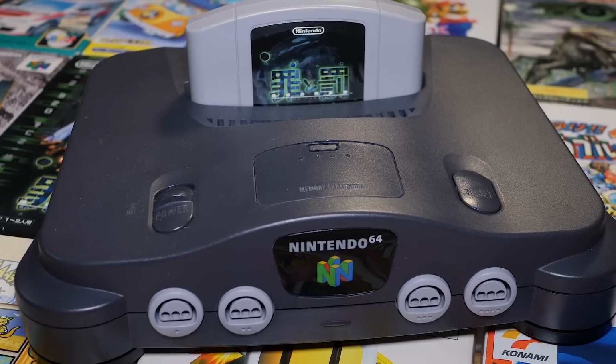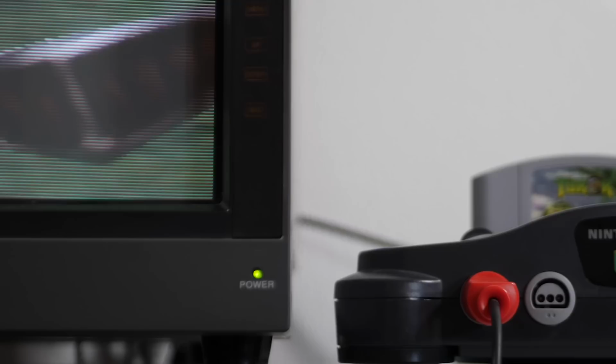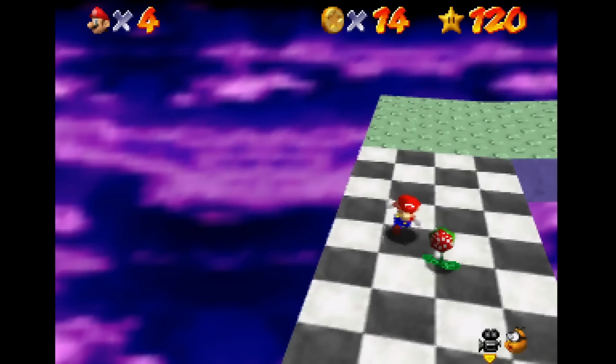And just like we did last year, we're reconvening, putting our minds together to discuss another Nintendo HDMI solution. So, first off, the N64 is a little bit complex from a video standpoint in the sense that, I mean, you know this, of course, it doesn't support things like RGB video natively. S-Video is the top end option that you can get by default in an unmodified 64. And so the actual best options for video quality are stuff like the UltraHDMI and Tim Worthington's N64 RGB.